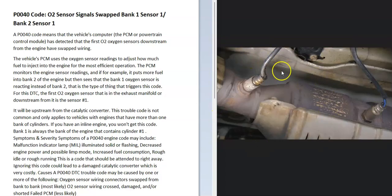What does this mean? The onboard computer uses sensors located on the exhaust, and they monitor how much oxygen was burnt off during combustion. The onboard computer then uses this information to adjust the air-fuel ratio mixture going into the engine.